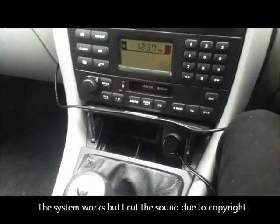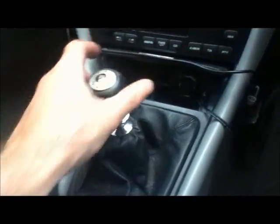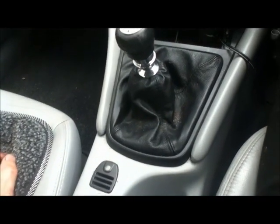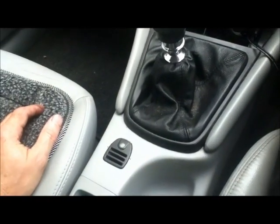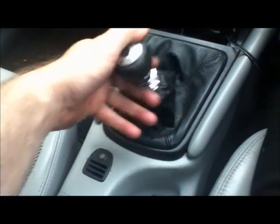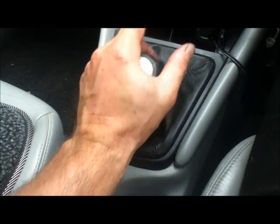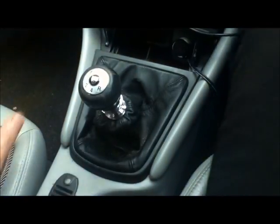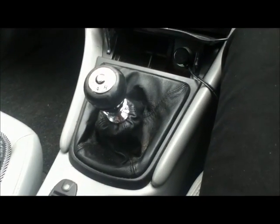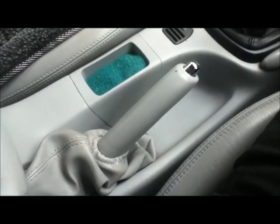Obviously while you're sitting with the engine running, just try the gears and see if it will pull it off the handbrake. So put it into first, the handbrake's on, and now it's pulling it forward. That's not good. That's because that's not done up tight. Well, now it's really fighting it. So the handbrake's working, that's good. Let's pop it into reverse. Lovely and smooth. Now, 9 times out of 10 you'll have already done this just driving it, but if it's somebody else's car, it's worth doing that just to make sure. Especially if you're thinking about buying the car, you really need the handbrake to work, because that is a shed load of work to put that right if it's not correct.